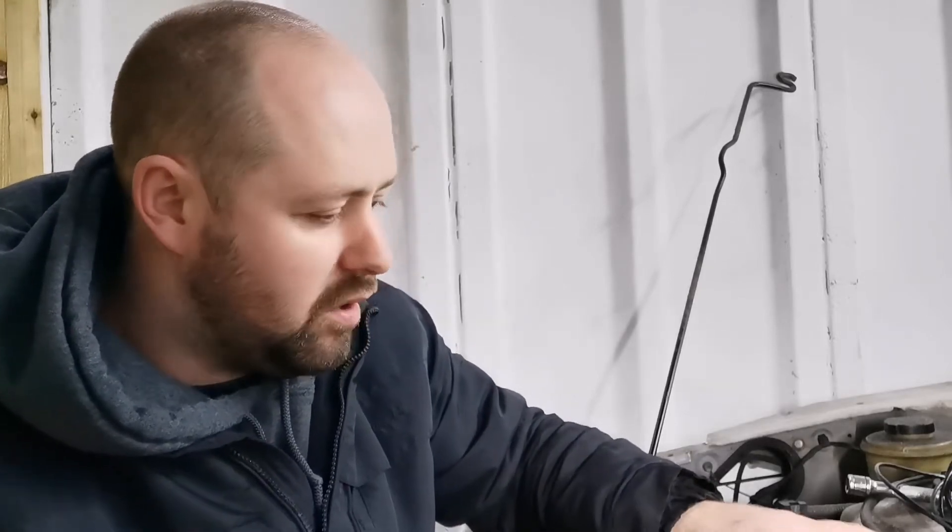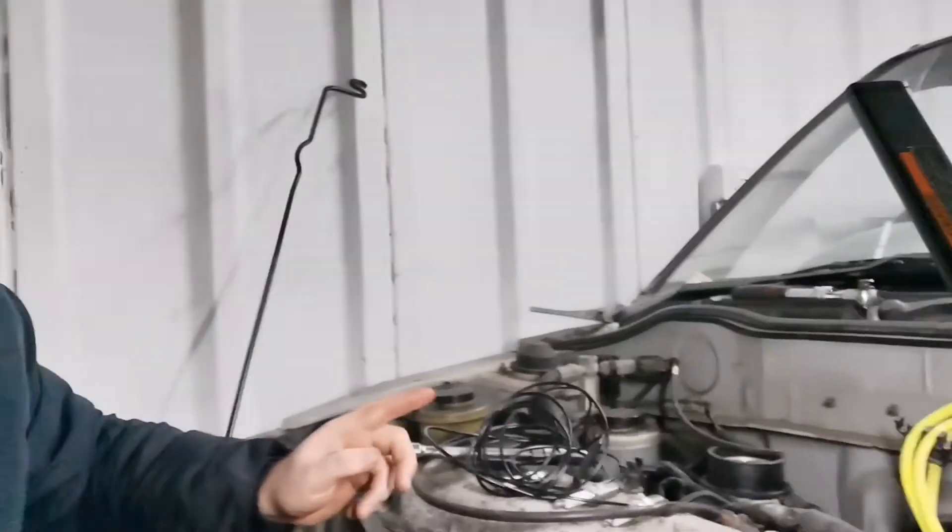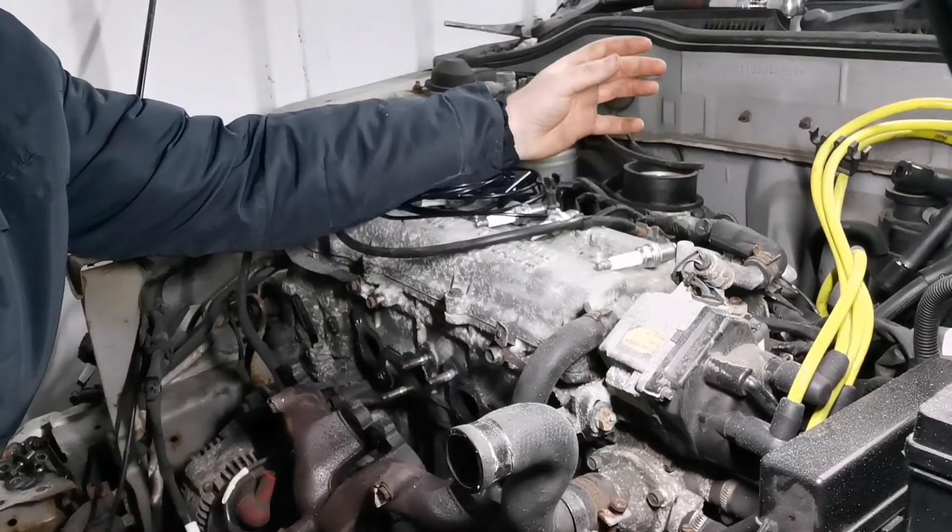There's not really much to see and it's pretty much what I expected — it's coked up. But referring back to the other engine, it's a million times better. It's what you'd expect for an engine that hasn't moved much recently. A good blast and it should be okay. I did notice exhaust valve one seemed a bit wet but I'm not 100% on that. The idea is to replace most things anyway — I've got a rocker cover gasket, new bolts, and the exhaust will probably be changed as well.